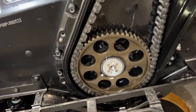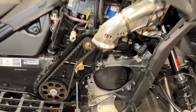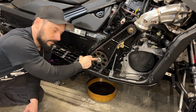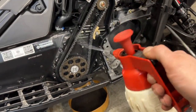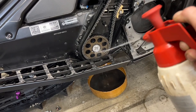Now that our bolt is installed and the magnet is on, we can reinstall the chain case cover, muffler, and brake cover on the other side and button it up. We will not be reusing the original magnets — that goes in the garbage. Before I reinstall the chain case cover, I like to spray it down with some brake clean to clear out all that old metal, and then we'll reinstall the cover.